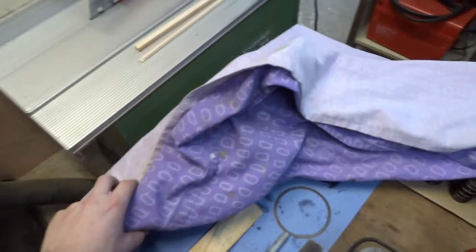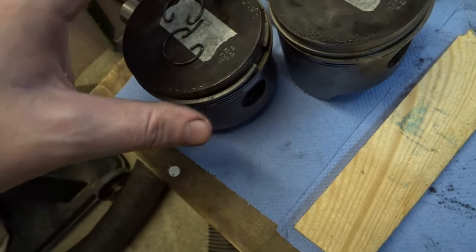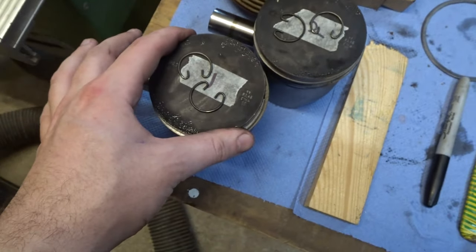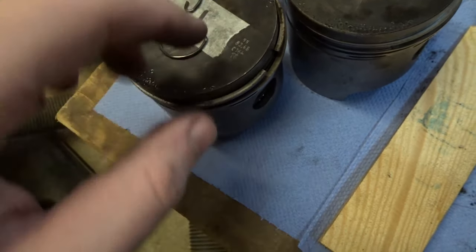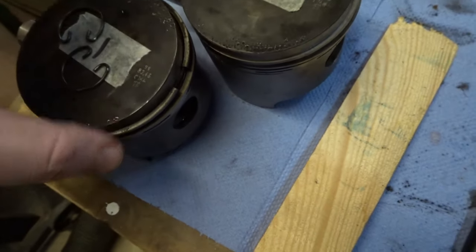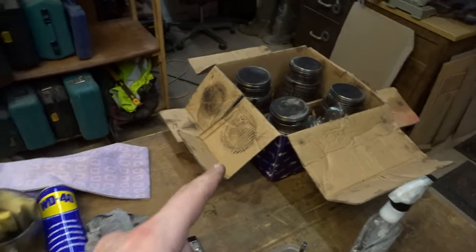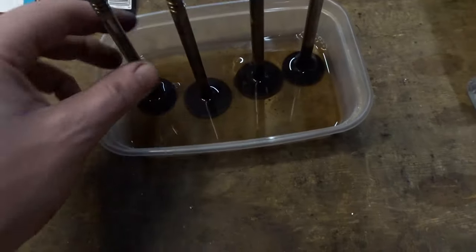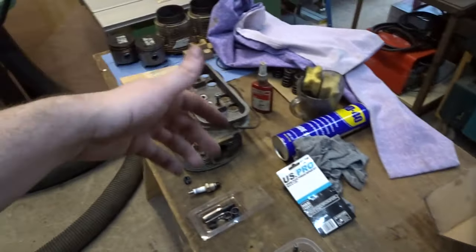With my old barrels and pistons, I did notice the piston rings had about a 4mm gap — they're far too small for the piston. These are 83.46mm oversized pistons, so what I think happened is somebody rebuilt this engine at some point, bought the 83.46mm pistons but used the stock 1500 piston rings at just 83mm, and didn't correctly gap them. They just chucked it together and it ran but smoked like hell. So I'm hoping these new ones should be a little bit better. All that's left is cleaning off the valves — I didn't get nearly enough carbon off with the Dremel so I've put them in degreaser overnight.